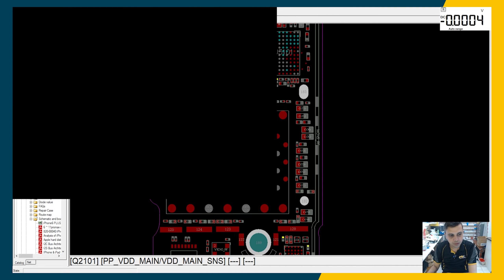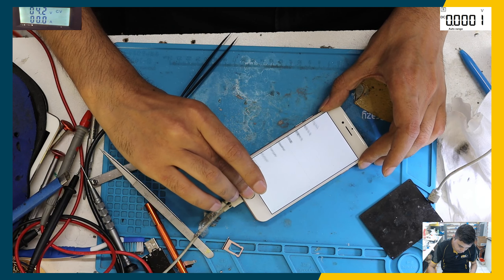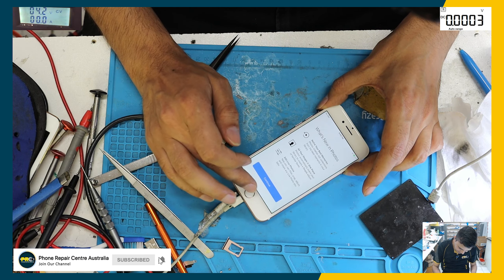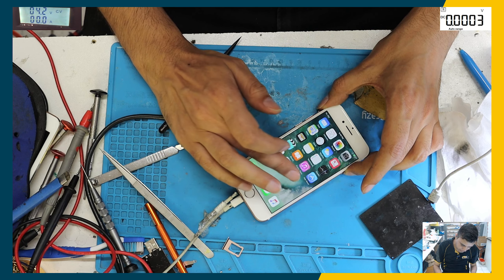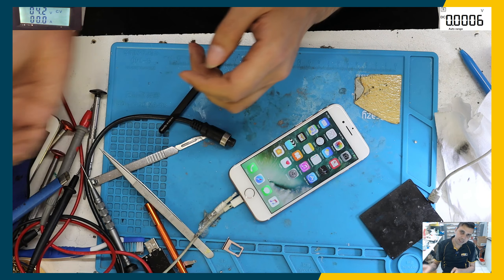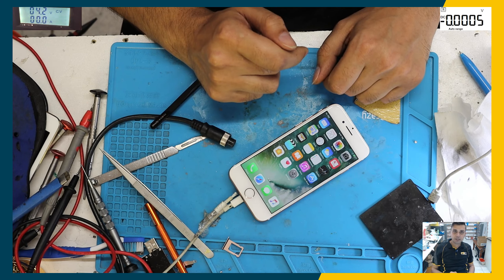Instead of fully flashing the phone, try to kick it out of recovery mode and see if it works. The phone has already reset. The 3uTools activated it automatically and there's no iCloud lock on it — that's fine. So the lesson here: if you miss that diode mode reading under the boost IC at the beginning, the fault on PPVDD main short is going to come back again and again. It's better to follow the diagnostic process and get things done in one go.